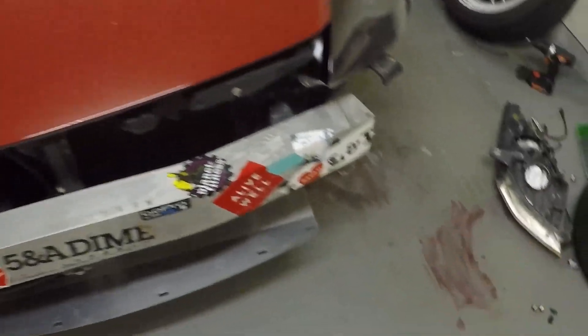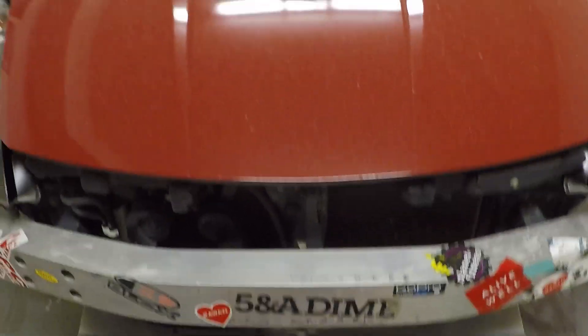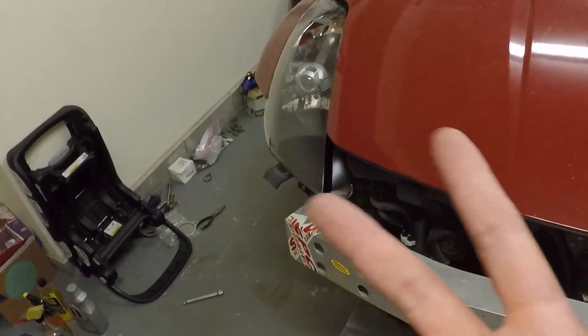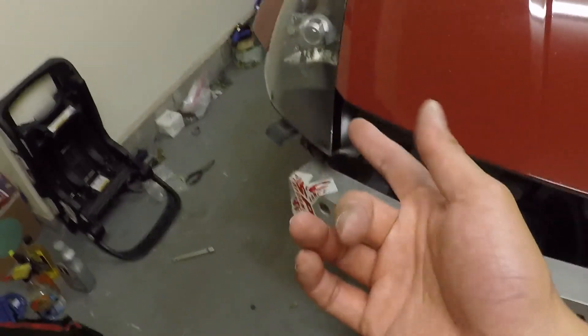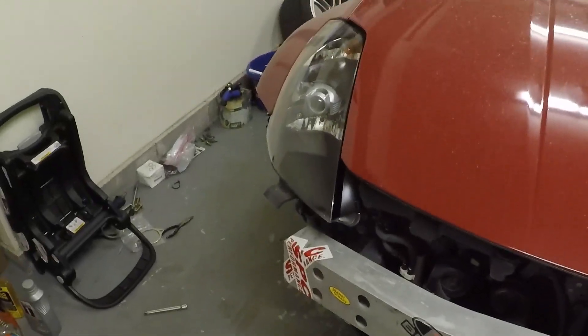So with that being said, I wasn't running any splash shields, which is why I bought this undershroud and those two wheel covers. My headlights went out and I checked the fuse — one of them was blown. I replaced the fuse and still nothing. I bought new bulbs and everything, still nothing. So I bought one ballast — because I didn't want to buy two and waste around a hundred dollars at 50 bucks each — to see how that goes. Moment of truth.